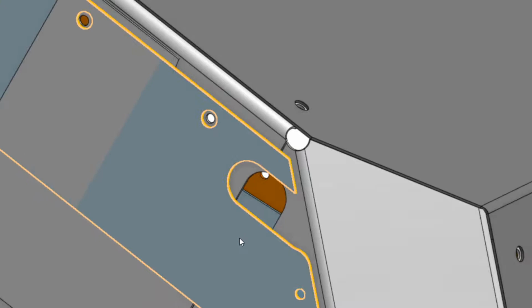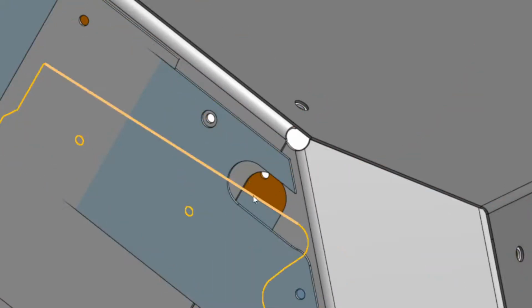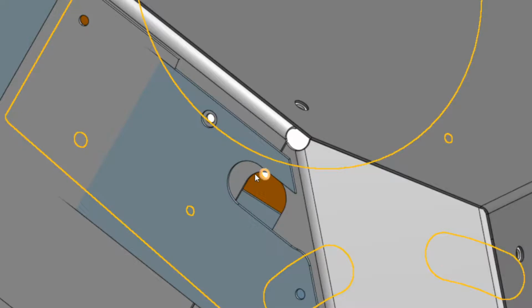Now if you put it on and that actuator rod wants to rub on these edges or it doesn't fit there, you can trim any of these 3 pieces to allow that actuator rod to come through wherever it needs to. It may also do a little bit of sideways movement as it moves out and actuates the turbocharger wastegate. So make sure that again that has clearance.